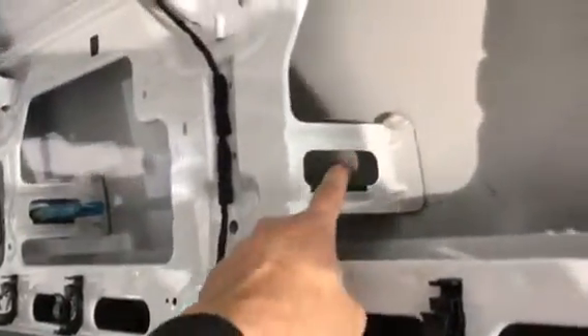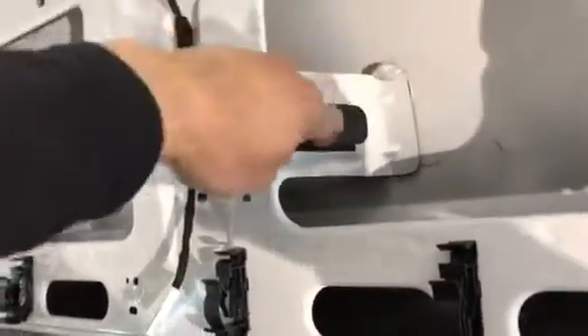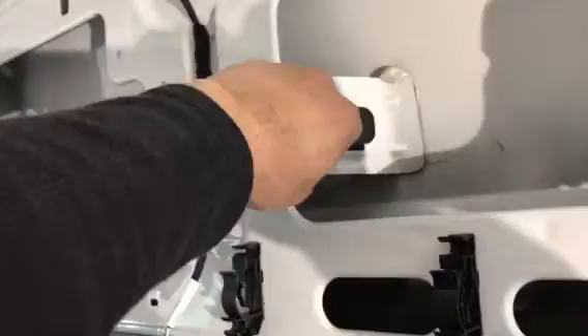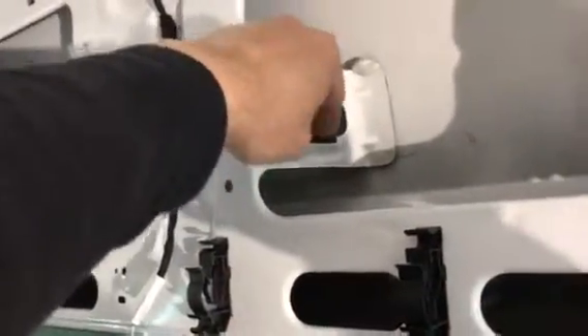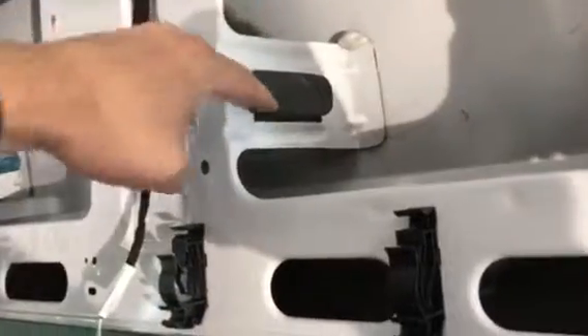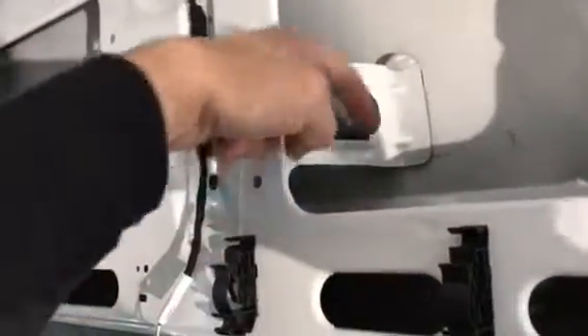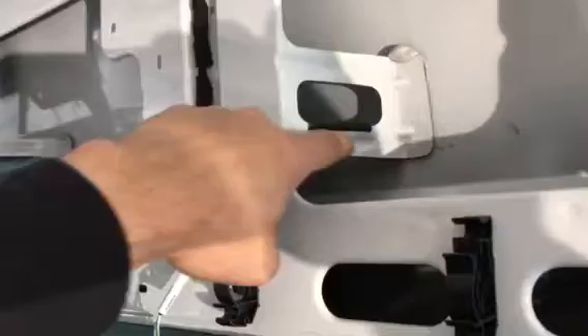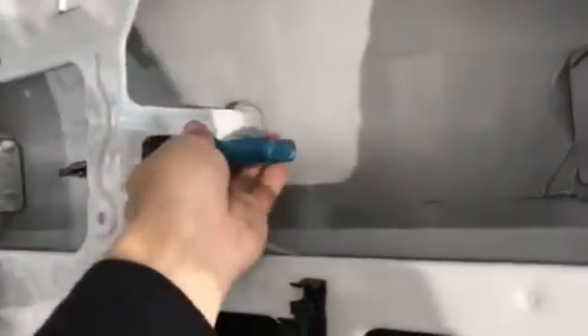The plan is to run the wire here. I put this protector — it came from Home Depot, it's water irrigation tubing — I just spliced it and covered the wire through here in the middle. That way, whatever I decide to apply on this side of the panel or the other from the exterior, I won't have to worry about the screws coming in and pinching the wires.